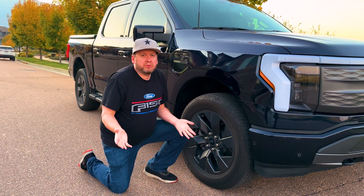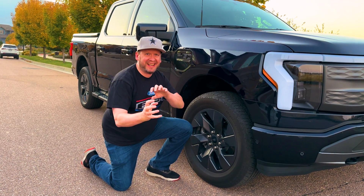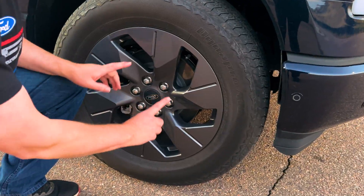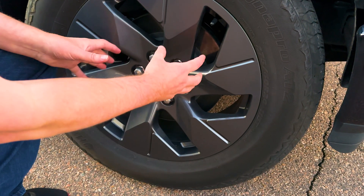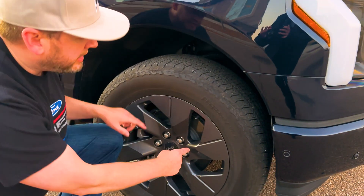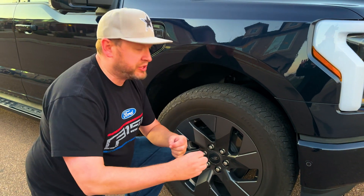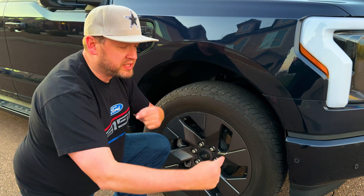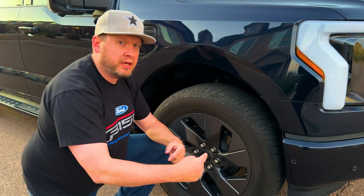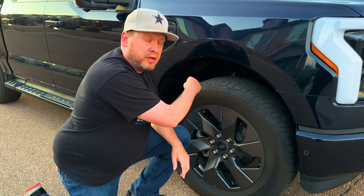First of all, I wanted to answer the question: what is regenerative braking? Regenerative braking is as the tires are going round and round — kind of like a windmill — it actually takes that kinetic energy and converts it into power that can be used for the vehicle. Ford does this through an electrical traction motor inside that uses that energy as it's spinning around to convert it into power. What's happening when it does that is it slows the car down because it's a generator in there generating that energy as it's spinning. So regenerative braking is basically braking as a result of that energy being converted from kinetic to power that can be used. That energy is then sent to the batteries.